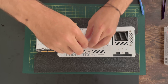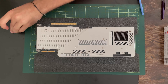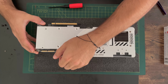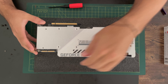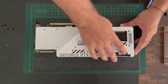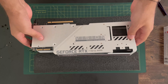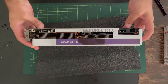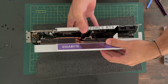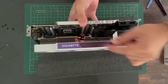Now we can go ahead and open the back of the card. This is the back plate — you're going to remove these screws, they're not very tight, and you're just going to lightly pry it off. Make sure you've got all your screws out. There is a small wire here that powers the LED of the Gigabyte, so make sure you remove that wire when removing the back plate.